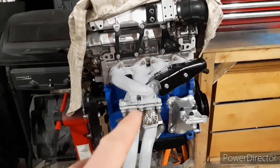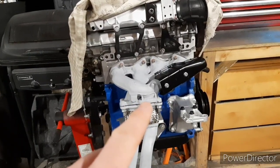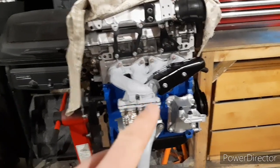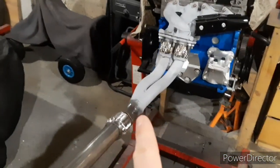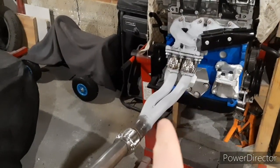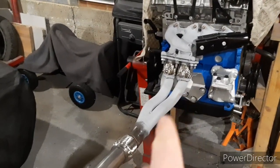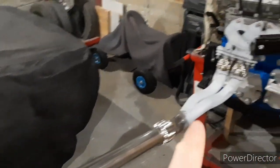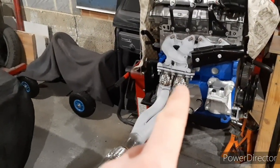And in some of the previous videos, you'll see these sections here have been opened up to about 51 mil, which is a lot bigger than the standard, which is just the size of the actual standard gasket. That's gone on there. This, from there up to there, was a downpipe off a Mk2 Golf 2 litre 16 valve, purely for the nice easy pipes. That was 30 quid. That was 12 quid. I think they were like 8 quid each. The flange is the original flange off the 16 valve downpipe.